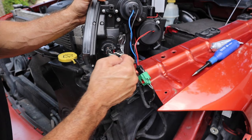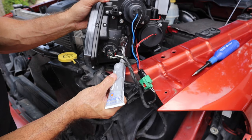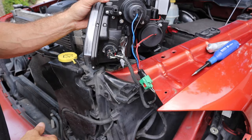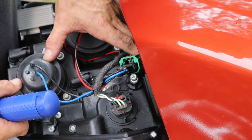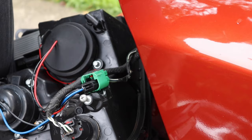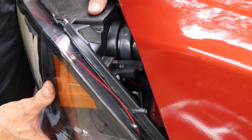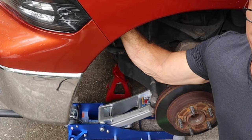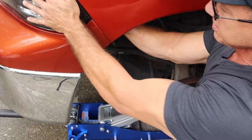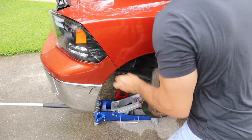Now I want to put lube on this because we want it to release every time. I'm gonna pull my light out — this grease will not hurt it. This part right here is sealed. The other light that came with it — just make sure the boot is on there completely locked all the way. Now we'll put the light in. Keep these wires out of the way; you do not want to pinch your wires when you're doing this. If you have to, tape them — tape them to the back of the light so they don't go anywhere. I'll line it up to the hole, push it in, go right back to the same lever, pull it down — now that's locked. Push this back up and put my push button in.